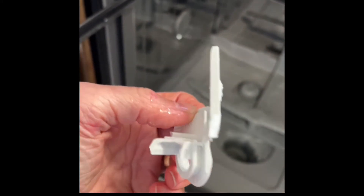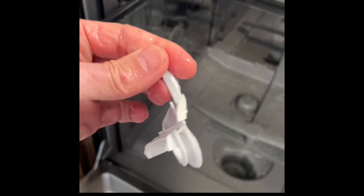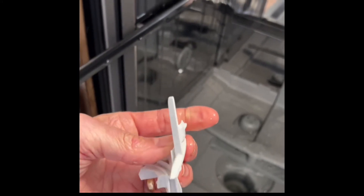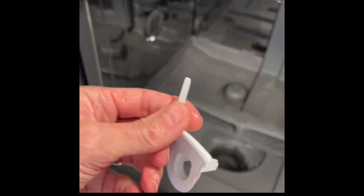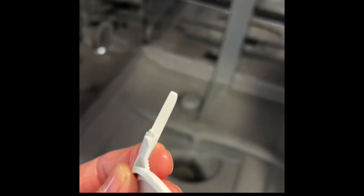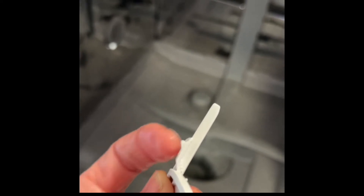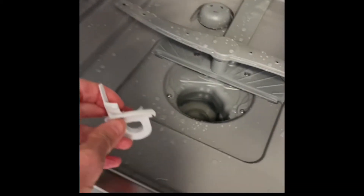This little thing is part of the drain system. On the new ones, sometimes these things get loose. This is the impeller cover — it covers up the little propeller that spins and creates the drain pressure. When it sits inside the dishwasher, it sits down this way, and if you look carefully there's a little tab right here, like a little triangle, where my finger is. That should be pointed toward you when it goes in.